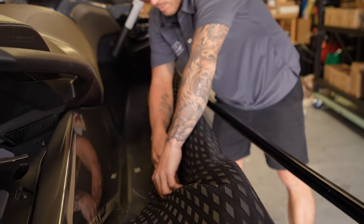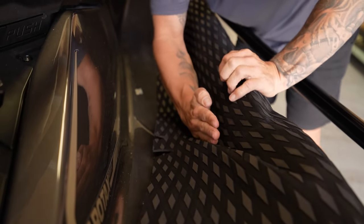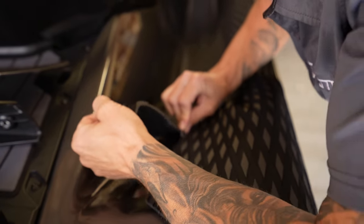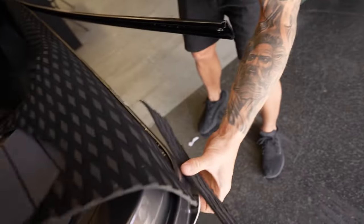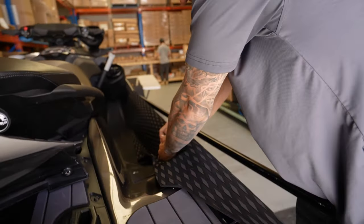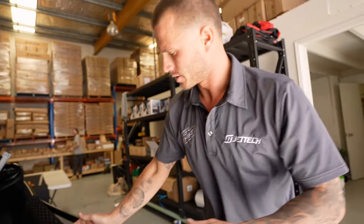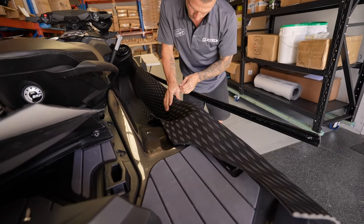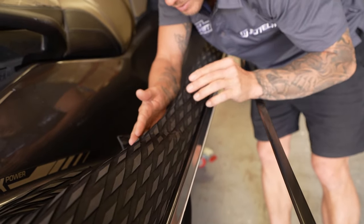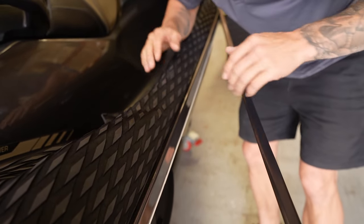You can see here what I mean about stress release cuts — that's got approximately 10 mil gaps and has made it easier to get it down. Make sure with your excess you don't cut too much away. You may notice I'm trying to work in sections as I go up and down the rail — not just doing one whole bit. The place to watch out on the Sea-Doo is this groove here. Two contradicting angles while you're trying to wrap it over and a kick-up — so you've got one, two, three, four, five angles there really. And shortly we'll get into feather cuts, as I like to call them.